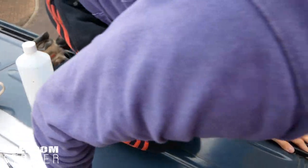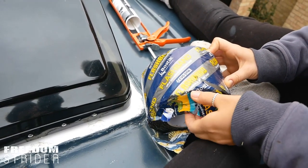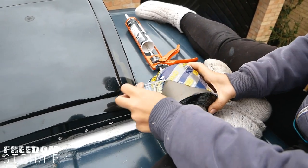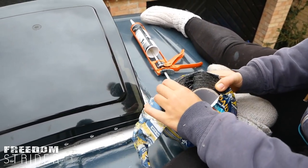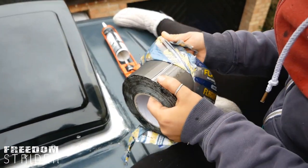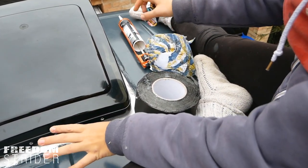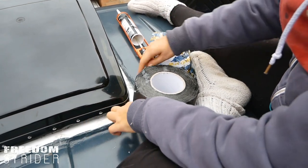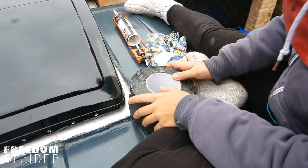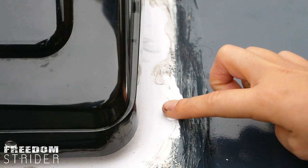Okay, I'm up. We got this thing guys — it's a flash band, self-adhesive flashing tape. I think it's used on roofs, like for roofing things. I think it's a smaller version of what that grey stuff is there. It serves the same purpose — it's like something between butyl tape, sealant, and tar. We can treat this whole thing as basically leak-risky and put tape all around the perimeter. But I was thinking we should maybe put sealant here anyway. Yeah, because we know that's a gap, just in case.